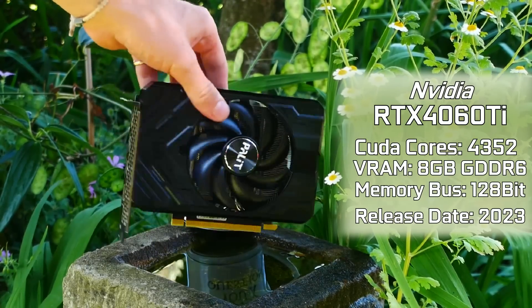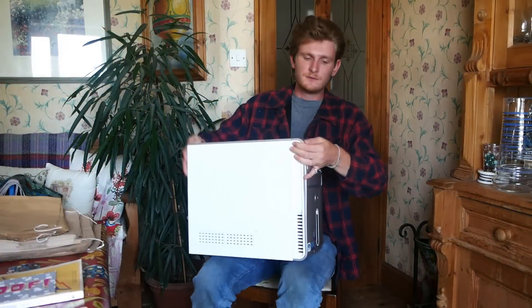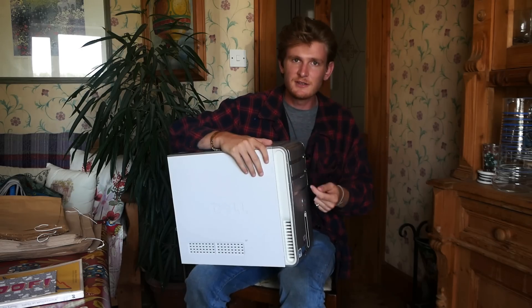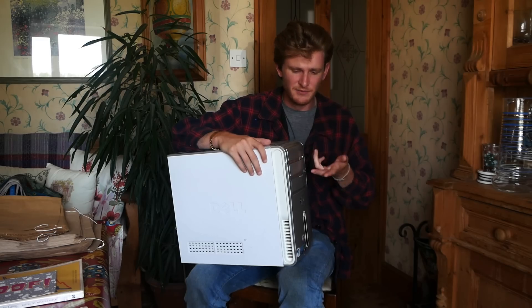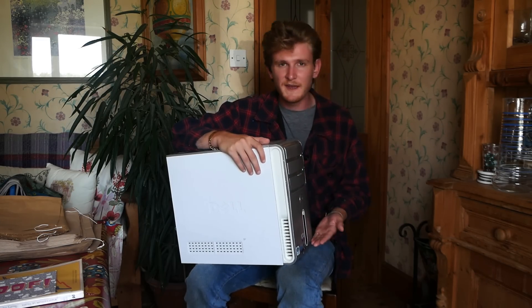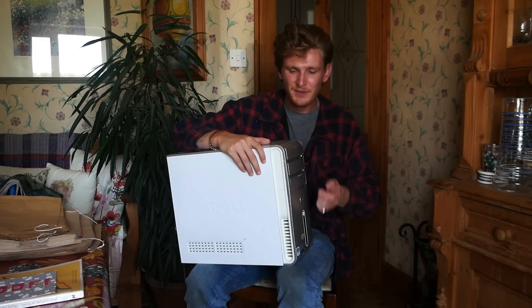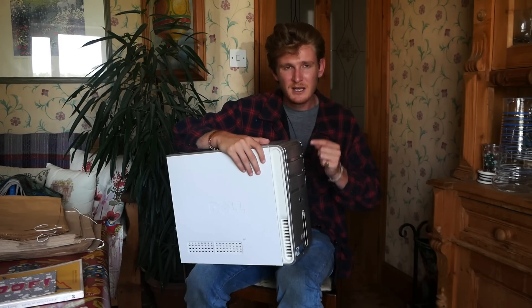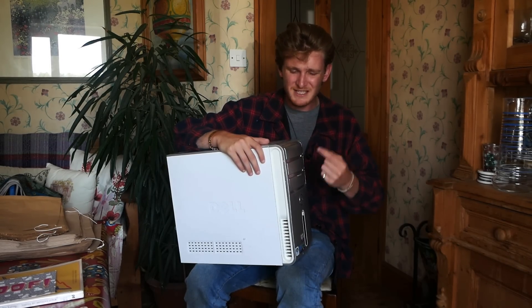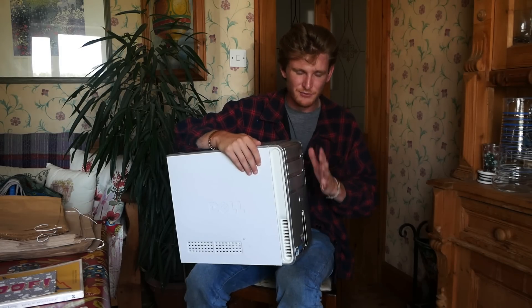But now we need to get back on with the video to actually see if this stupid idea actually works. To my knowledge, this is a G33 chipset in this computer. The G33 never officially supported the Pentium 4. However, this PC, being an old Dell, did actually come from the factory with Celeron D chips, which are more or less cut-down Pentium 4s. So if we modify the BIOS to take the microcode for a Pentium 4 rather than a Celeron, we should have a somewhat more modern chipset capable of running the RTX graphics card, yet with support for Pentium 4 processors.